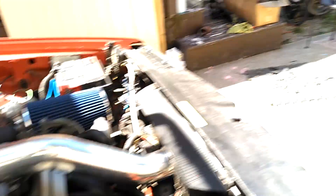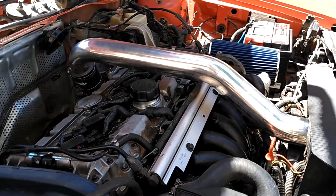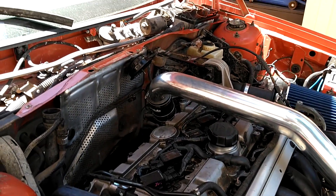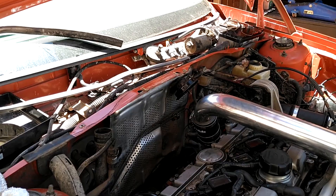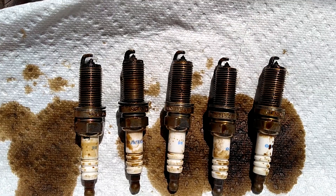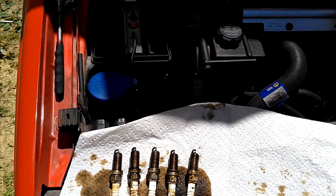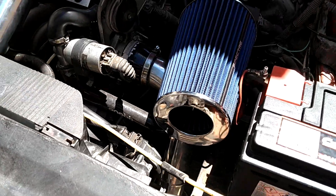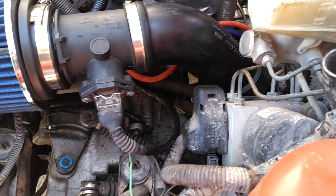When I check the level with this dipstick, it didn't go all the way in but it was at a certain point on the tip. To me, that means when I install this dipstick it reads at the low line — so what's low on this dipstick will actually be full on the other one. Let me dip it one more time to confirm.